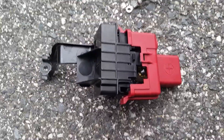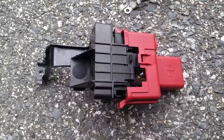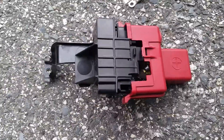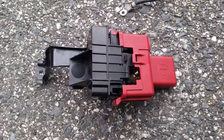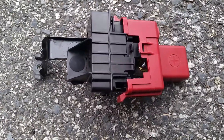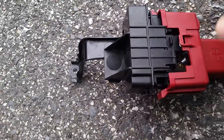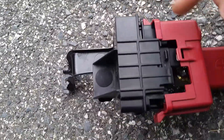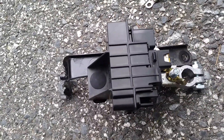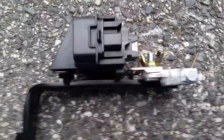If you've never gotten this deep into the battery area on your Prius before, this cover here is probably what you're used to seeing. It's a hassle to get off — it's almost easier to remove outside the car. There are three clips: one on each side and one on top. Get a screwdriver and pop them loose, then it'll slide off.